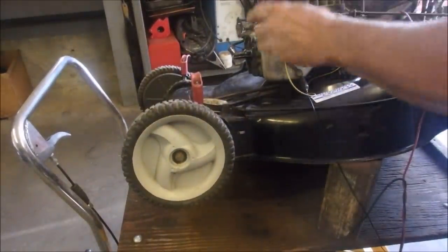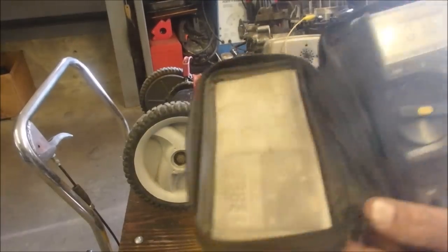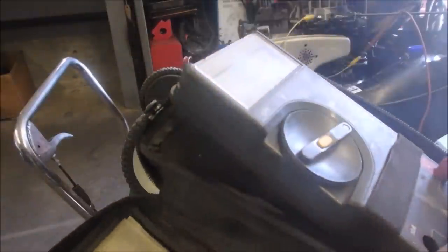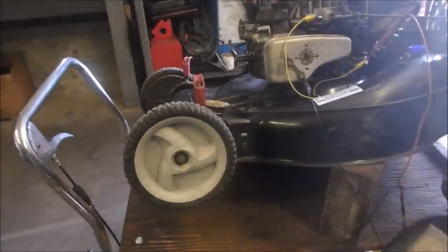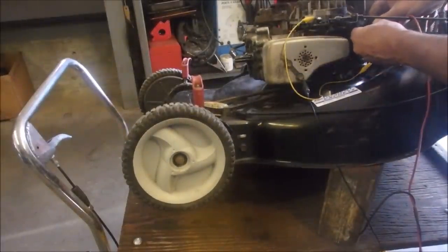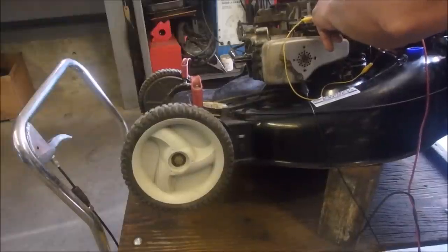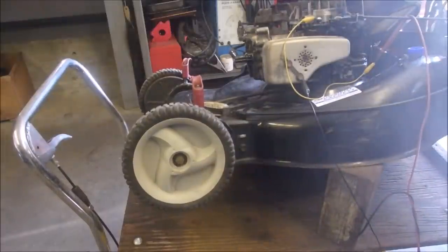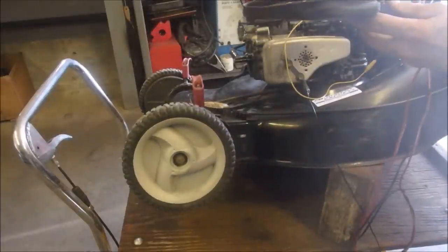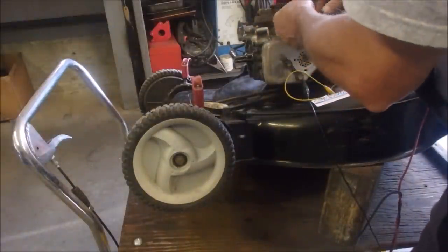So I've got the coil disconnected, right? And I'm seeing 1.2 ohms. You guys can watch it with me. Okay, 1.2 ohms. I have to reach a bit. And it goes to open. Now, the big thing is we're going to plug the electric starter back in. And that shouldn't make that much difference. Open. Perfect. We're there. Now let's plug the coil in.